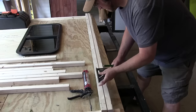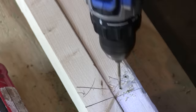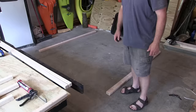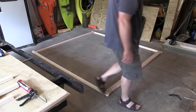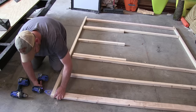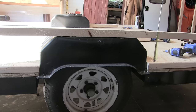For the framing of the camper, I used 2x2s for the studs in the wall and 2x3s for the corners. For the ceiling, I had planned to use 2x3s but I changed my mind and went with 2x4s. I also changed my mind on the front wall — it gets a lot of wind resistance from being towed down the road, so I felt 2x4s would be a better choice. It also gives a little more wood for those angled boards from the shorter portion of the front wall to the roof to screw to. One thing I think is very important: if you're using small lumber like 2x2s, you definitely need to pre-drill every single hole, because as soon as you start splitting that lumber you're making it weaker and it's not going to last as long.